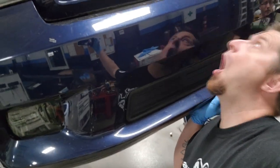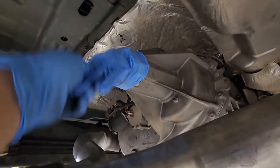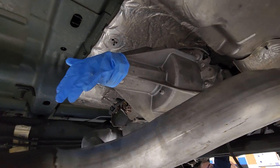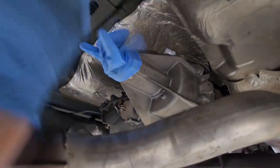So we just let it down and unhooked the battery real quick. We're about to remove the starter — obviously you got hot power going to that starter, so you want to make sure you have the battery disconnected before you play with that starter. Now, when you pull your drive shaft out of pretty much any transmission, what works good to not get fluid constantly dripping on you — a good old rubber glove and a handshake there, fella. Works pretty good. I've even seen people cram actual rubbers on there, but anything gets the job done.